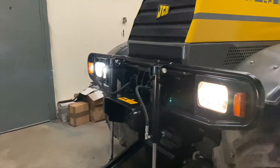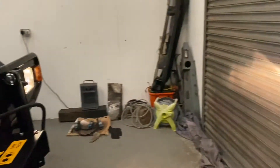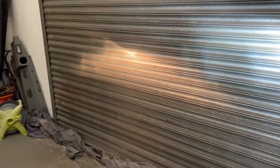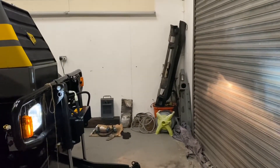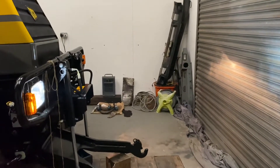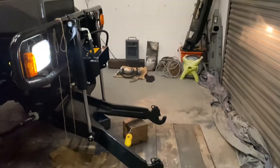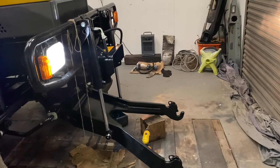You know, they should help the job if I can get them to fit properly. I wouldn't say they were however many times brighter, but they certainly look a lot brighter. The difference here — the old one on the light meter is putting out 2000 lux, and the LED is 10,000 lux. The distance for that measurement is probably about two to two and a half metres. There's still some ambient light in here, but that's quite a difference. So I need to persevere and try and get it to fit properly, and then try and do some headlight alignment. Deep joy.